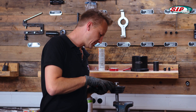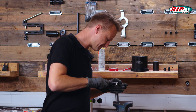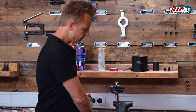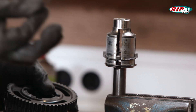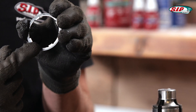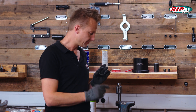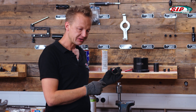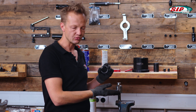Let's say I found it has 0.4 millimeters of clearance, which is the maximum allowable play. I open the main shaft clip and take off the gear plates. On the sides of the gear plates you have spacer shims which are available in different thicknesses, and by changing the thicknesses you can adjust the clearance down to 0.1 millimeter.